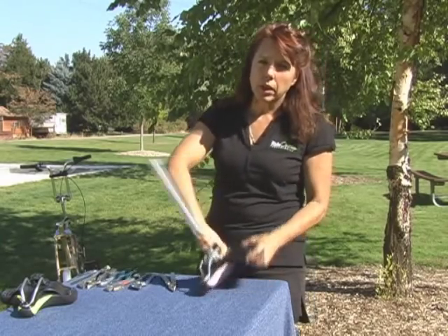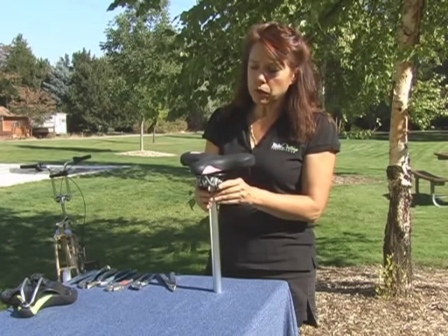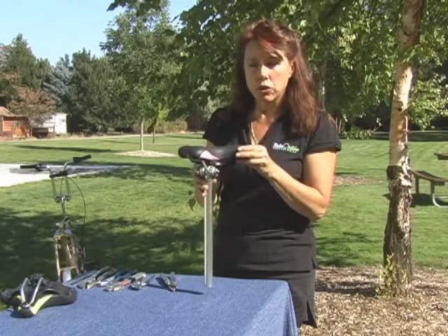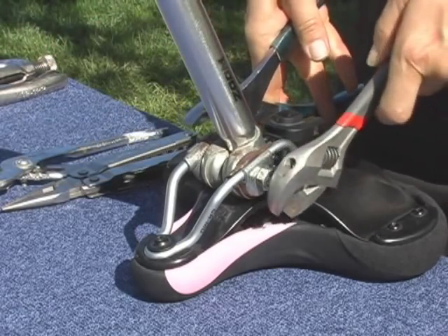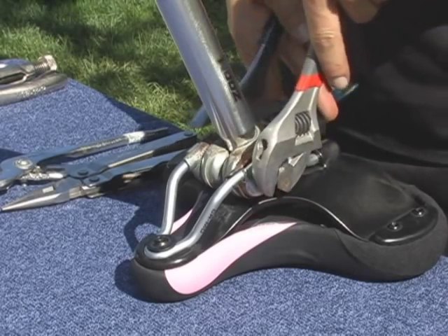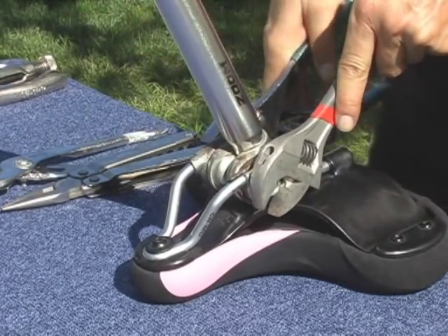Take a moment and turn this upright. As every bike is built differently, you'll have to adjust this angle once you get the seat on your bike and you ride your bike a bit. Using your tools again, you're going to tighten them down, this time bringing the tools toward each other. Tighten the nuts completely.